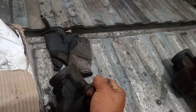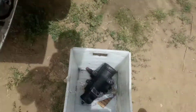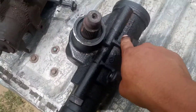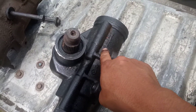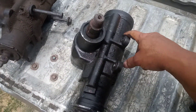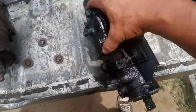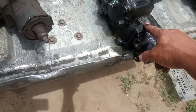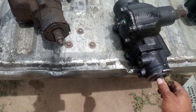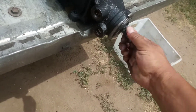Last week I got bad feedback on eBay — this is the box that guy sent in. It's a random box with a four-mounting-bolt-hole style, which I've never seen. I think it's some kind of aftermarket box — it's not a six-casting. This one has a three-quarter shaft, some kind of AutoZone seal in it, a rebuilder's mark on it, and metric fittings, which is not something I'm able to reuse or re-send to somebody.